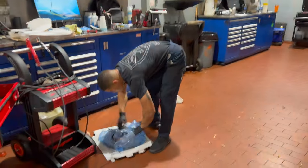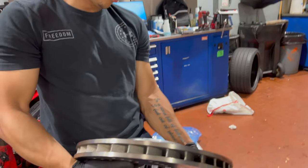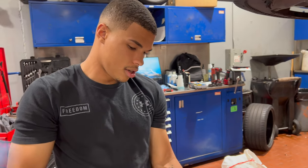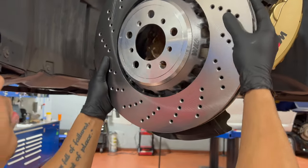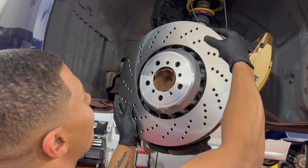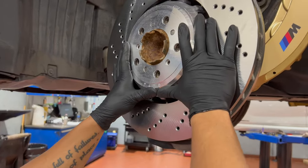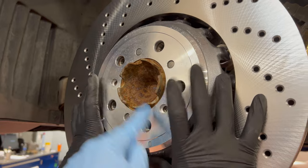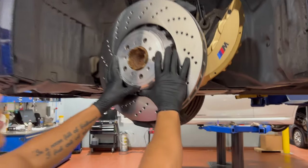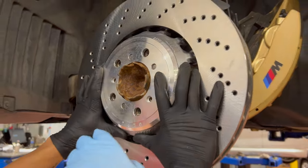Benny's gonna put this one on — I'm just gonna record this. That way we can hurry this process up. We were talking about the part numbers — the odd numbers are normally corresponding, so odd is left, evens are right. And they also tell you on the rotor itself. As he sets that in, it has little pins. These pins fit accordingly — there's a little bevel for the bolts. You're supposed to clean behind it, but mine wasn't that bad, so we're just gonna send it and be on our way.